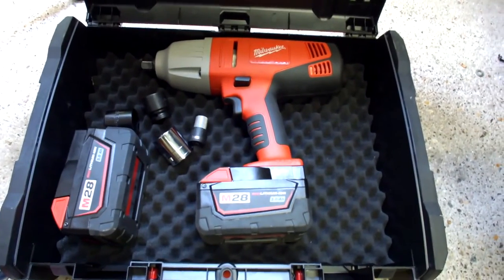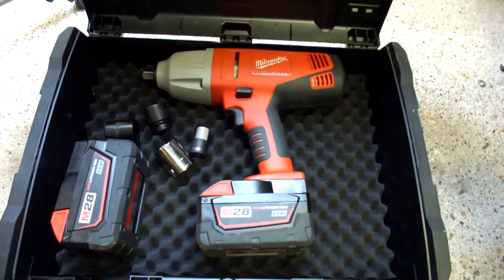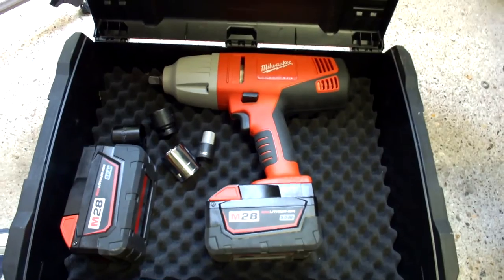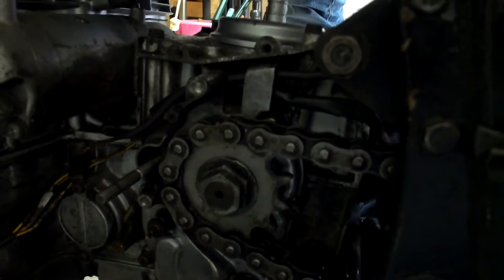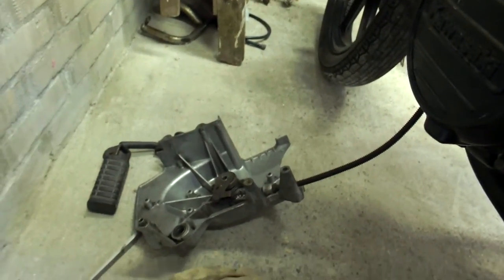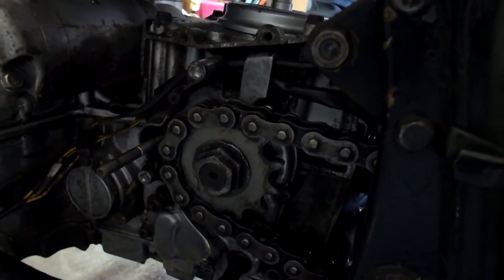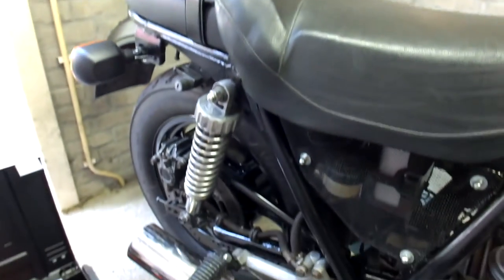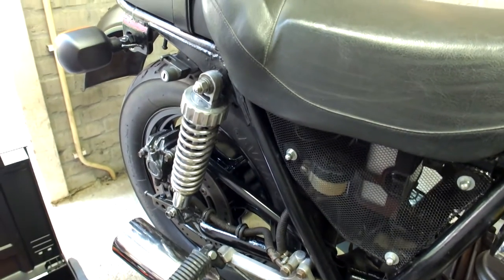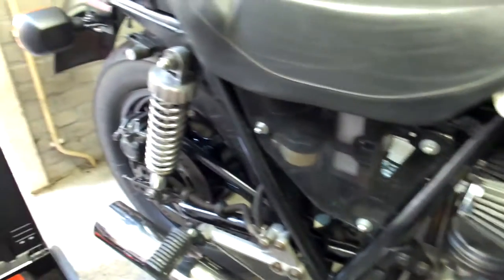Here's what I'm going to be using to remove the front sprocket nuts — both of them. There's a lock nut that's 27mm and a nut behind that's 32mm. Here you can see I already took off the left cover behind which the clutch is housed, and now we're going to try to take this sprocket off. Of course I have to block the rear wheel, and after I've been able to remove the nuts I'll let the oil run out of the engine so we can exchange the seals.